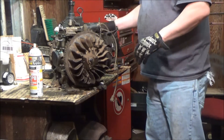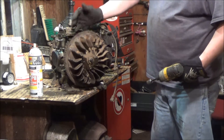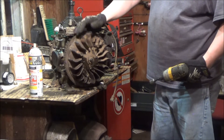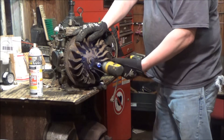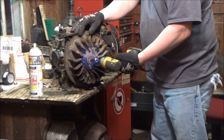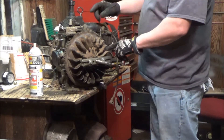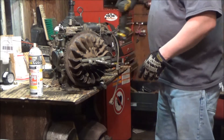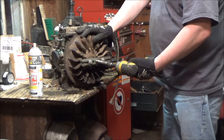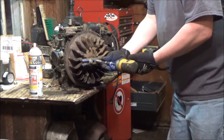Now we're getting the flywheel off. These big flywheels can be a real bear. I've already broke the nut loose. You don't want to stick a screwdriver in the fins to hold it — you might break a fin off. An impact works very well. I've already broke it loose, backed it out about a quarter inch, then mounted my puller using two of the four 3/8-inch holes in the flywheel. I turn the big nut to put tension on it.